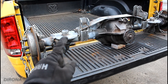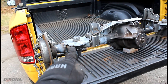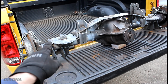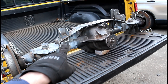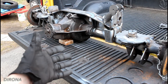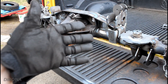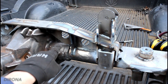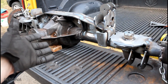Here's what we've got — all the brackets are welded on. I've got every weld done. You can see some white spray here and there, and that's just some weld-through primer. I sprayed anywhere I didn't think I'd be able to get with spray paint later on — for example, underneath these little cups on the coil spring buckets, behind the sway bar mounts right there, and maybe one or two other places. I haven't gotten this into the Jeep yet, but so far everything fit up pretty well. The kit was very straightforward, and if this thing fits, I definitely highly recommend this kit. The only thing we had to do to modify it was to trim a little bit of the truss around these welds where the tubes welded to the housing — other than that, everything fit together just like it should.